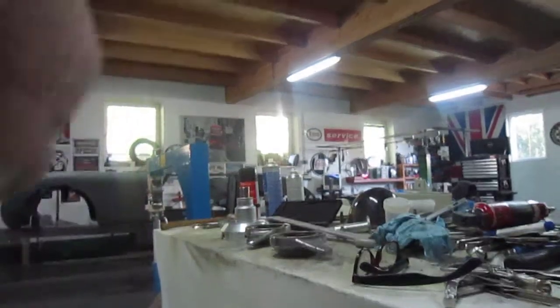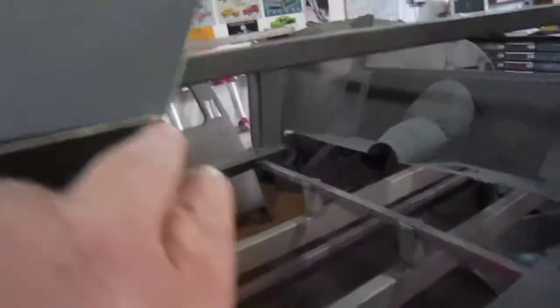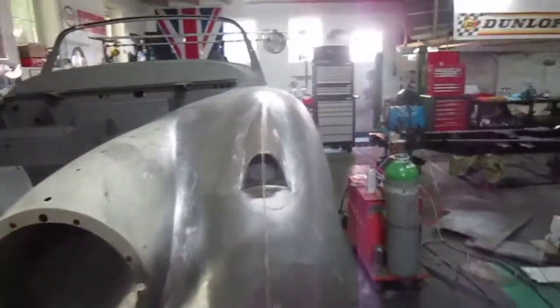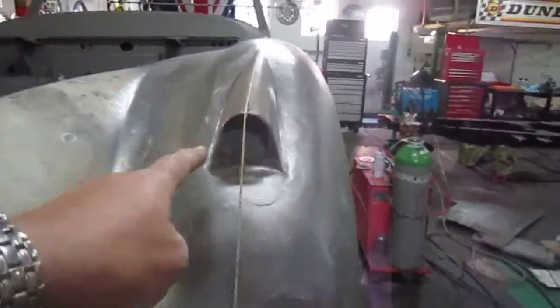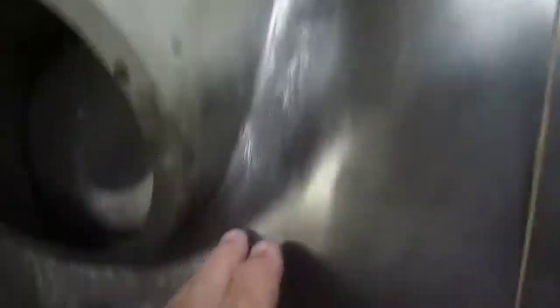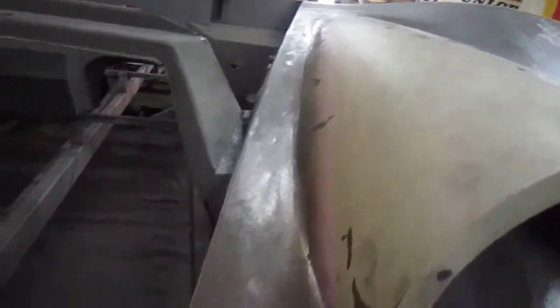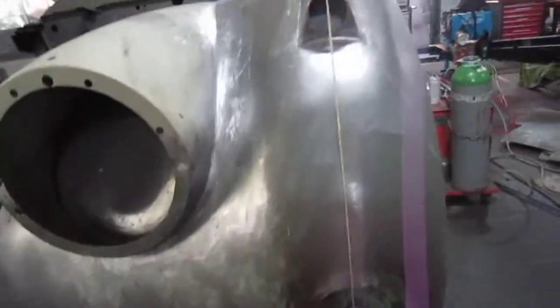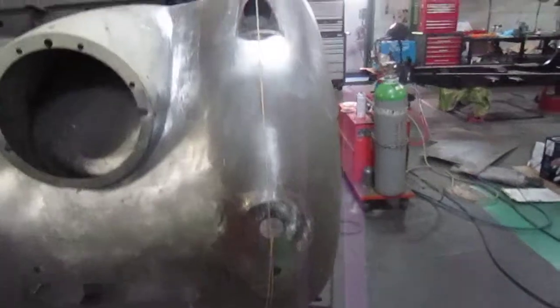So I want to pick up the car and show you what's been going on here. What Amir's done — I was showing you about this edge — he's put a piece of line on there to get an absolute straight line from that edge right on the top of the wing. As you can see, it's all lead loaded in, and so is that. It's not finished yet, but it's looking nice. Most of the lead loads are in — I'll need a slight filler to finish it off. But you can see the front's all been leaded as well, and it fits perfectly on that line right through the center.